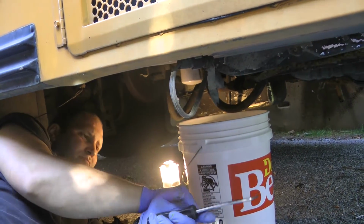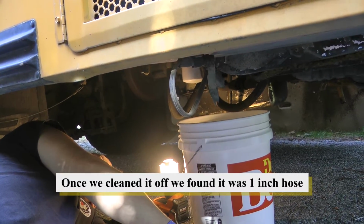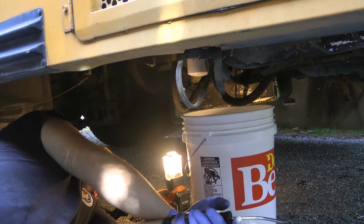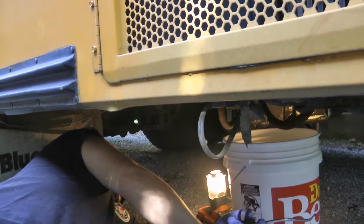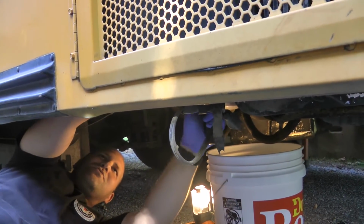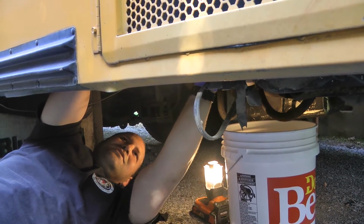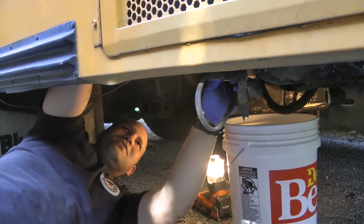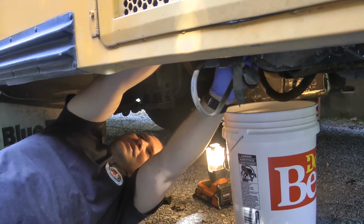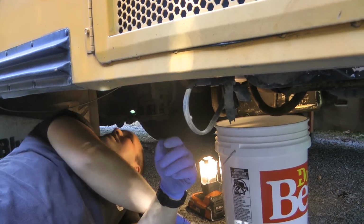So how much coolant is usually in the lines? Well, it's 3/4 inch line and it's 40 feet long, so it should hold a fair amount. I don't think it'll be holding more than 5 gallons, but it'd probably hold a couple gallons. But whether it's all sloped to drain or not, we may have to lift up the heaters. Plus, we've got that little U that goes under the emergency door that's going to trap coolant in it. So we're basically just going to find coolant everywhere as we take this apart.